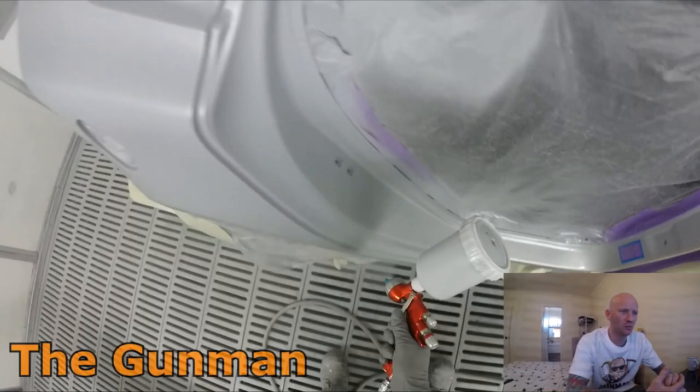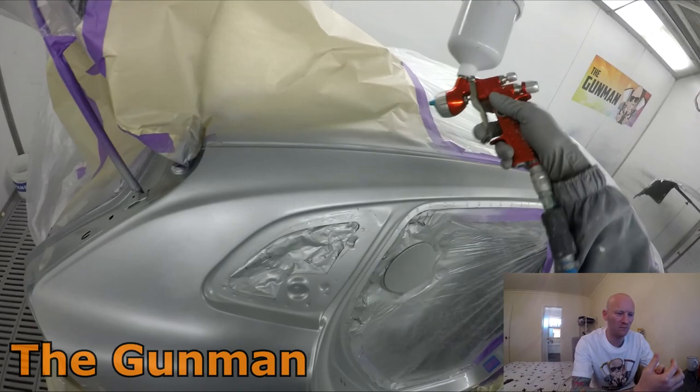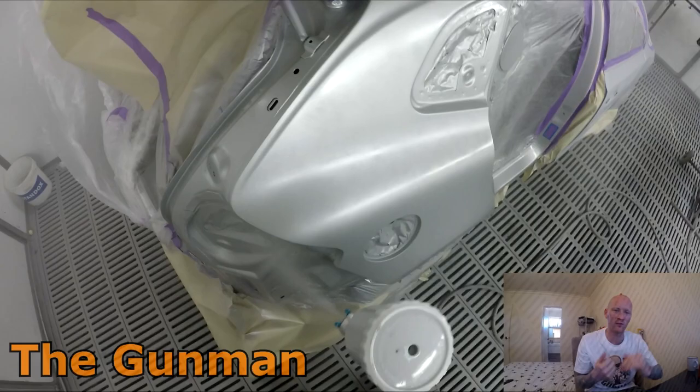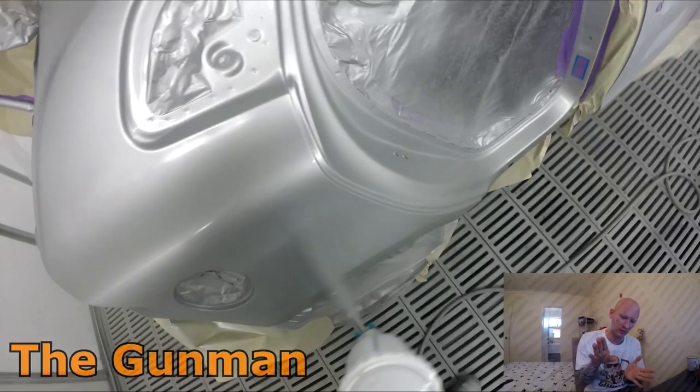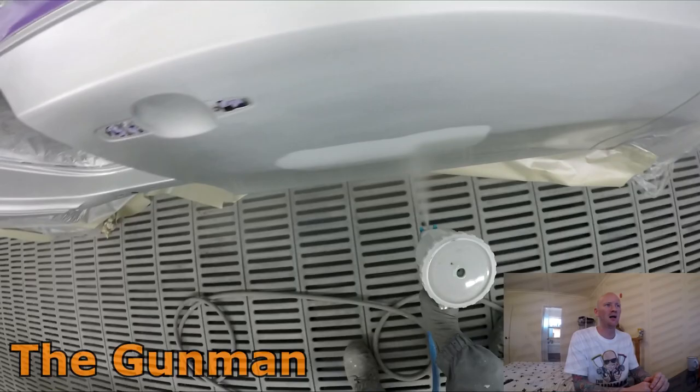I did this respray back at Spray Tech Finishing, where I had my own shop for a year. And that booth, the airflow is terrible in it. And I don't know why, but what was spraying at 1.5 bar perfectly with Standox in this booth was just over atomizing. You were starting to lose the center of your fan, and also had overspray all over the place. I don't know, different booths might even spray slightly differently. It's not outside the realms of possibility.